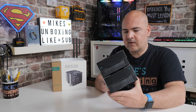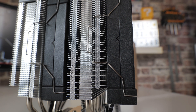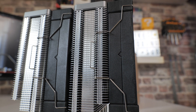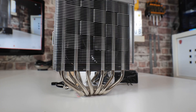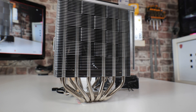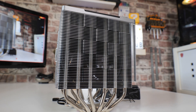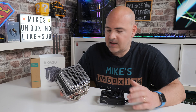The fan mounting system is very nice — using really nice wire clips. They're not on particularly strongly so you can get into them without much force, and they're very easy to use. Taking them off reveals the really nice waffle effect on the heatsink. I'm not sure if this helps with turbulence, but this thing is super quiet. They rate it at 28 decibels, which is actually very hard for me to measure as ambient noise in this room is normally 30 to 40 decibels. At full load you still can't hear them over the other fans. At around 300 RPM it's effectively completely silent, and even at the highest speed it's barely noticeable.